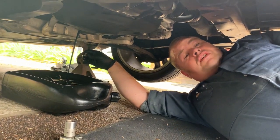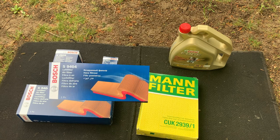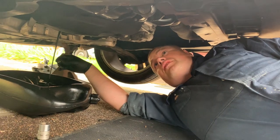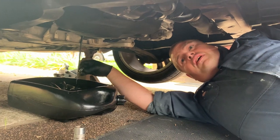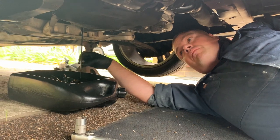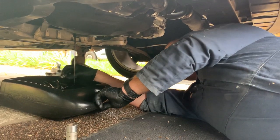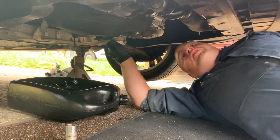We're going to change the oil filter, the air filter, the pollen filter, and the fuel filter. The fuel filter I only tend to do every couple of years, and to be honest I very much doubt that it needed doing even last time. When we have a look at it today I highly doubt it would need doing — not visually anyway. So we're going to let that drain for a minute. While it's doing that, I'm going to have a look at taking the oil filter out.